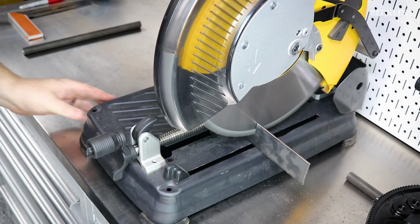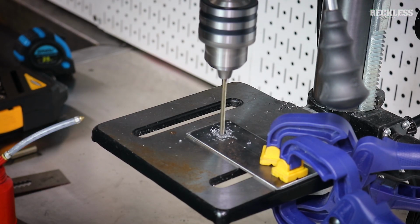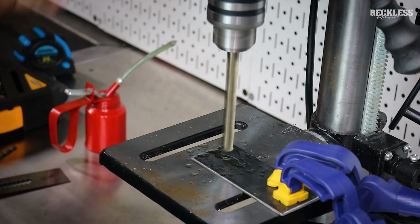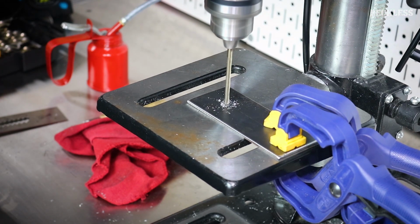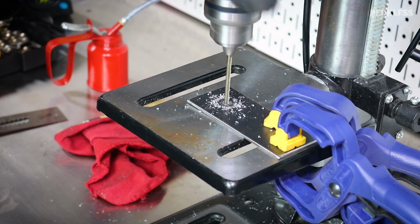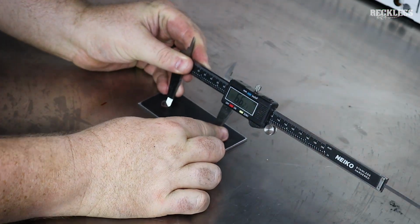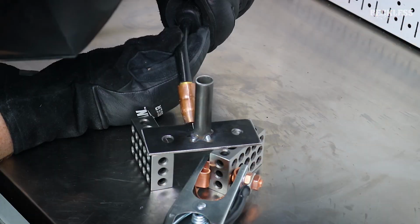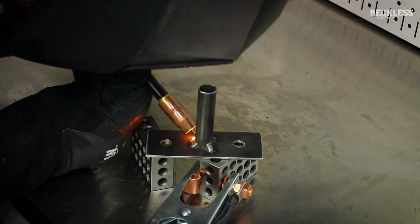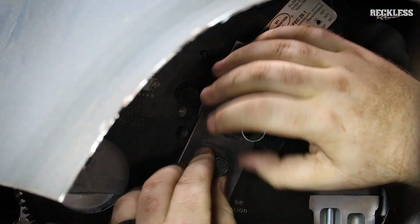This is a trick that I read on a forum, and I wanted to try it to see if it would work. Essentially, to set the angle of the engine, the tilt or the lean back or whatever you want to call it, what you do is you set the rear end perfectly square at 0 degrees. You level it, and we're going to whip up this little tool, and it's going to bolt onto the back of the flex plate. Once we have the tool put together, we'll put a laser inside of it, and we will set our engine angle based on where our laser points, and the goal is to aim that laser directly at where the pinion will be located on the rear end. What that gives us is a 0 degree pinion angle at the rear end, and whatever our final number is at the engine, say it's 3 degrees, we can then roll the rear end to split that number and make it 1.5 on each end.